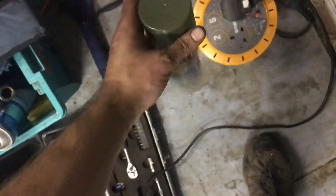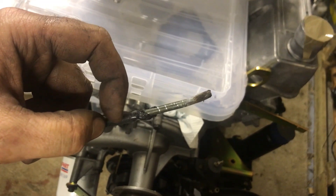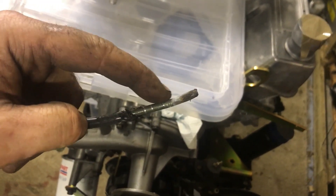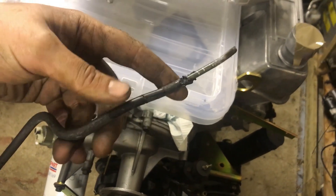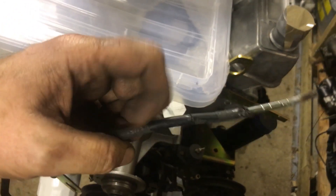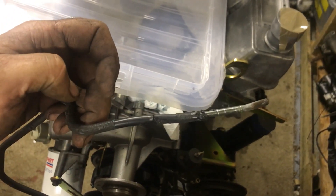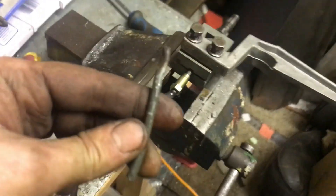The metal pipe under the plastic cover is mint apart from the last little bit. So I'm going to remove the plastic covering back to here, swage a new end on there, and then make a new end. If I don't have enough room I might actually have to cut the plastic right back further — that'll give me a bit more room. I've trimmed about that much off the end and I'm keeping it so I know how much to make the new copper pipe.